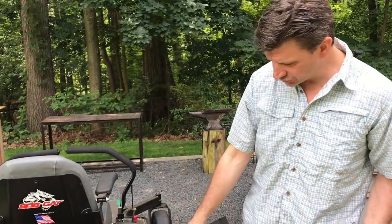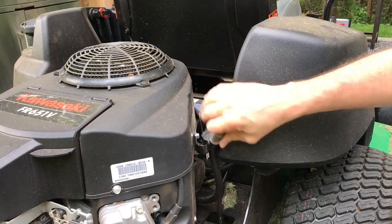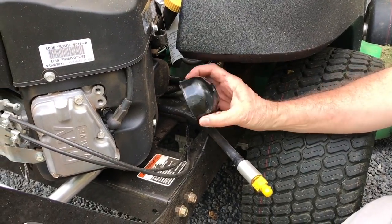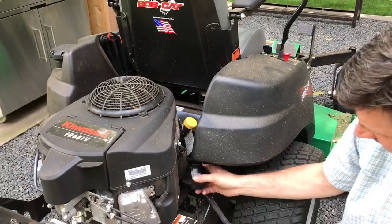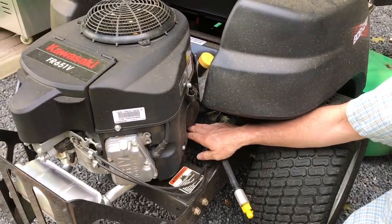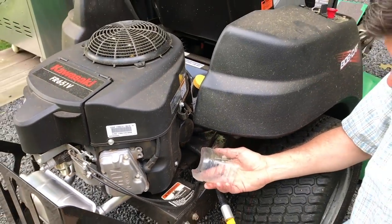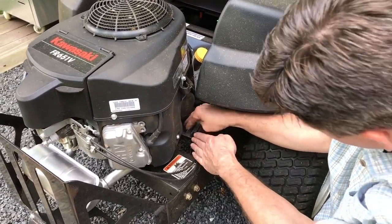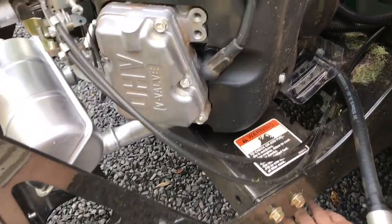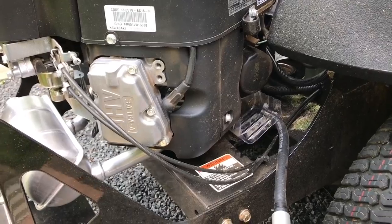One other thing I wanted to talk about is changing the oil, which is really easy. You've got this little drain plug right here — it just comes out and you can get the oil right into your oil pan. When you take the oil filter off, I like to use a regular oil filter wrench with a socket wrench, but it's hard getting in there. The issue is the oil spills back into the engine, so I use a piece of plastic cut from an apple juice bottle. If you squeeze it and work it into position it creates a funnel — put your pan underneath and it'll fall through the hole in the engine mount, saving you from making a big mess.